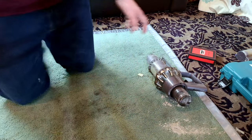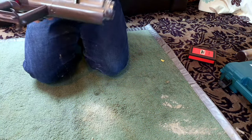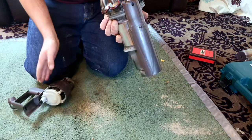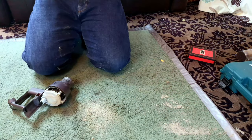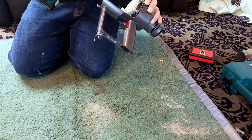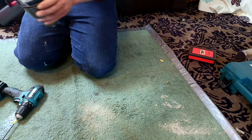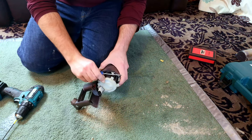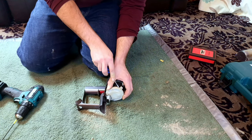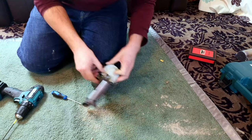Hello, my vacuum cleaner chums. This is already spewing out a phenomenal amount of dust and I've done us the liberty of getting to this stage already. We need to carry on in here. So we'll take out the two torx screws holding the motor cover into place. I'm wondering at the age of this — it's not under warranty, they did confirm that — but I'm hoping it's not got that glue all over the motor that Dyson use nowadays to discourage home repairers. And it doesn't, and that's good.